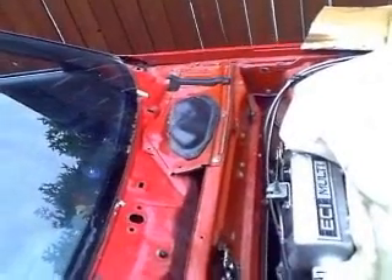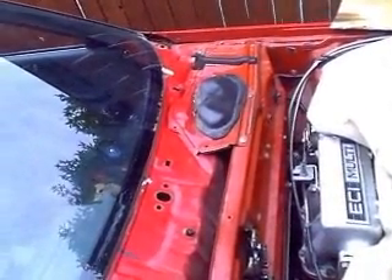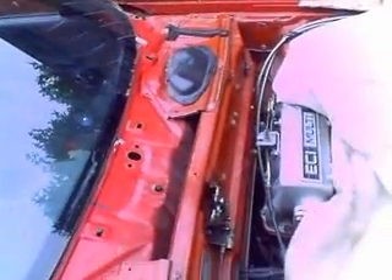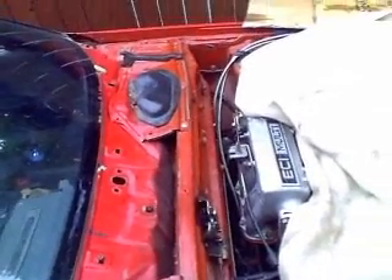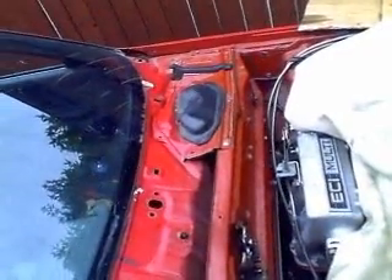As you saw, the car is running a complete exhaust system — it's really complete. It's got a 2.5 inch dump pipe and a 3 inch exhaust system, mandrel bent. It's going to have a 3 inch dump pipe and continue on with the 3 inch mandrel bent exhaust system. It's not an open exhaust, so what you heard is the car running as it is. It's fully enclosed and that's how it sounds.